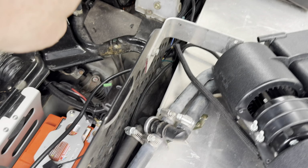Well, every time I put in a brand new alternator, boom, dead. The one I got from the junkyard that came with the motor, I bought a brand new one, boom, fried it. Returned that one, brand new one, boom, fried it. I was like, fuck. So then I start looking into it. There's a wire that goes from here to the computer. I don't know what was going on, but once I disconnected that one wire that went to the computer, to the alternator, everything's been fine since. And that's been, what's that, 5 years? Going on 6 years now, yeah. So that lasted pretty good.